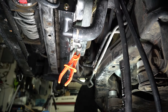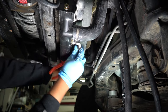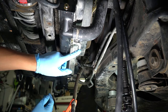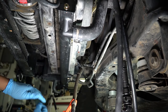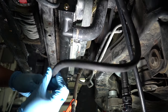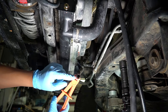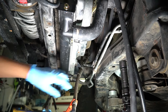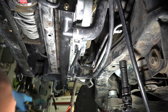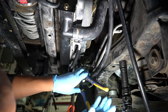It should leak a little bit — get your cup or cardboard ready. It didn't leak much. This is the return line, so what I need to hook this up to is the top of the transmission cooler. I kept track of which line is which — it's my Continental line. I'm going to take off this existing clamp so I can reuse it, and hopefully it fits. Just slide that on there — that's as far as it's going to go; it's really tight, but there's enough to get the clamp on, so it should be plenty.